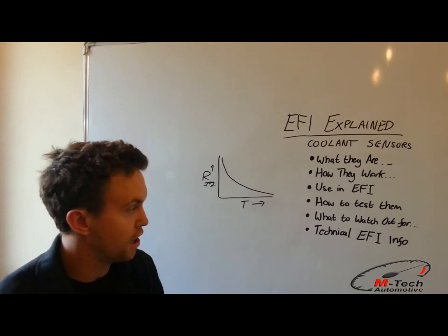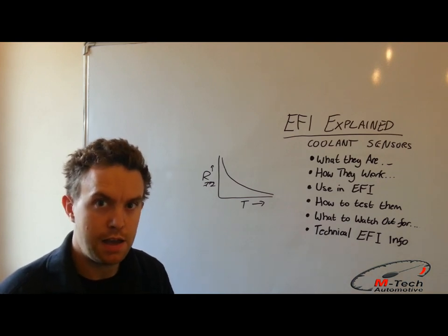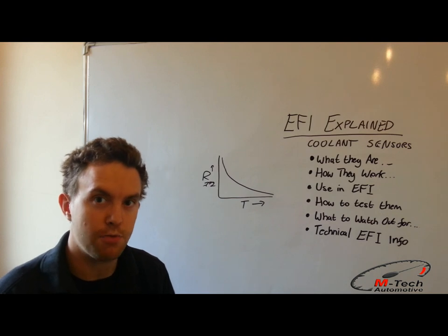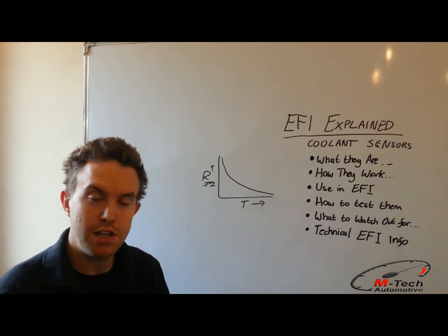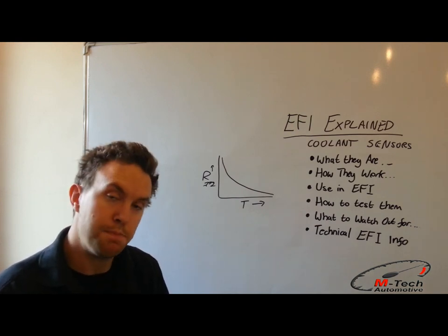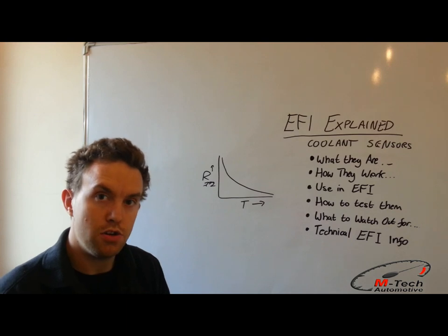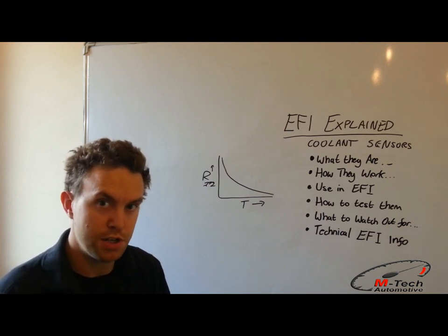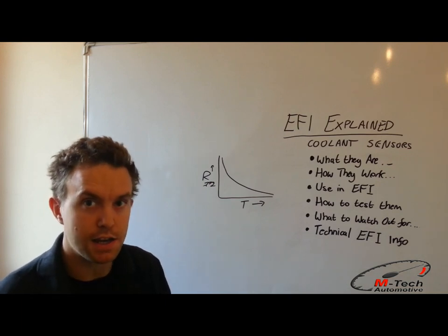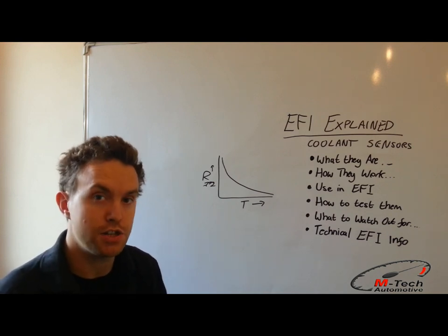So what is the use of these sensors with relation to electronic fuel injection? Well, back in the day of carburetors, most people would pull out a choke when first starting the car, because when the engine is cold, the petrol doesn't atomise very well, so you need a bit more fuel for a good combustion. The ECU looks at the temperature reported by this sensor, and if the engine is cold, it puts in slightly more fuel — a multiplier of the fuel table. It's also used during cranking and starting so the engine management system knows whether the engine is cold or hot, and can put in the right amount of fuel to get the engine running properly.